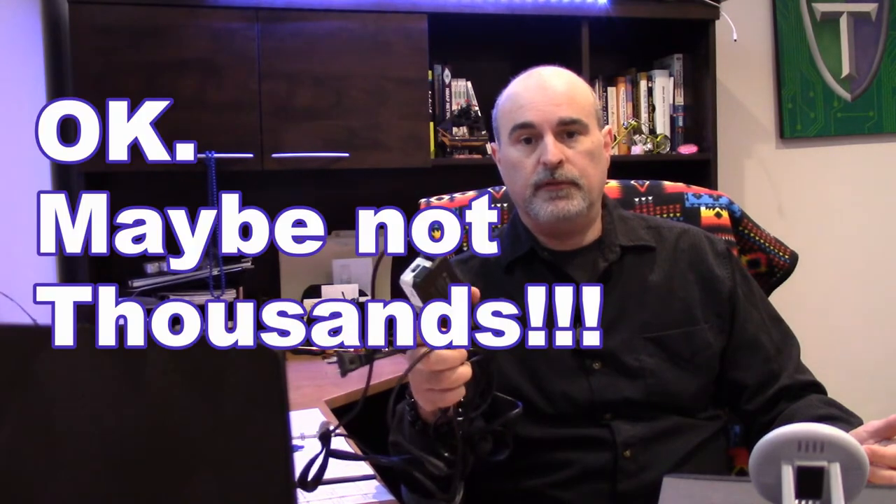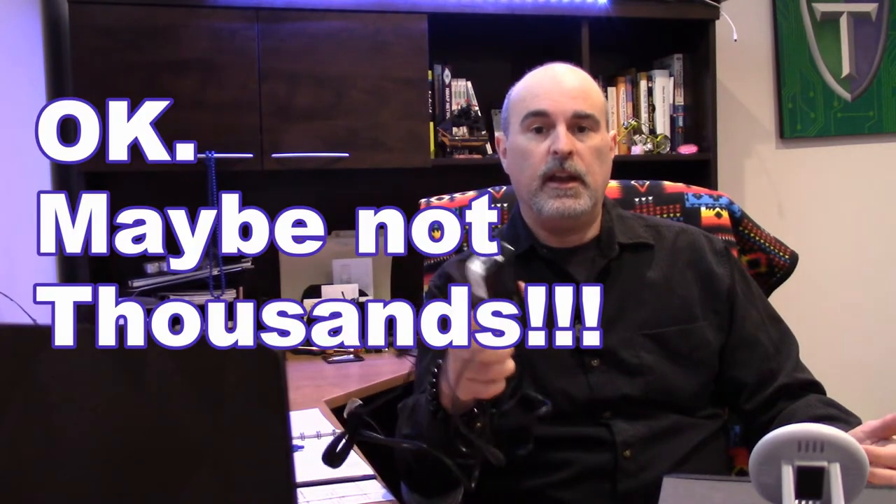I've got two to show you here today. These are basically used a lot for technicians such as myself. I've been using these for a couple of decades now. It's great because whatever laptop comes into my shop, if I want to test why there's no power going to the laptop — maybe it's the adapter — instead of having hundreds or thousands of different adapters, I can have a universal adapter with different voltage ratings and hook that up to test it before going and buying one.